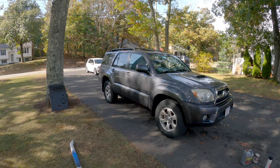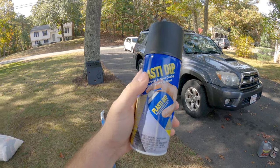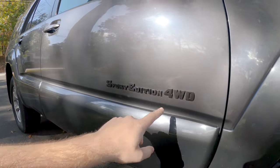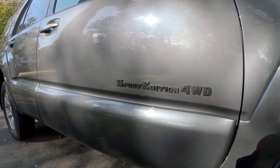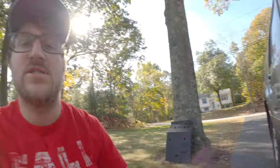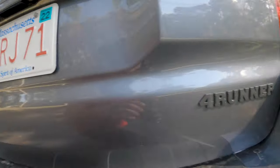The second thing we did to the appearance was Plasti Dip — it's basically a rubberized matte finished coating. There are other colors available; a lot of people Plasti Dip wheels and emblems. Alongside the step rails, these emblems were also fading and peeling. We taped them off, gave them seven or eight coatings of Plasti Dip, and then the excess just peeled right off. It is so satisfying to do — it made us want to find more things to Plasti Dip. The Toyota emblem and 4Runner lettering came out really good.